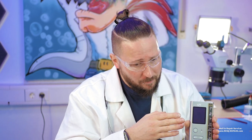We can use glue which we heat to dry, or UV glue — whatever you prefer. But you always have to calibrate it correctly. Sometimes after gluing the dot back to the prism it doesn't want to detect your face and you have to recalibrate by hand. This takes time, and time costs money because during that time we could be doing other jobs.